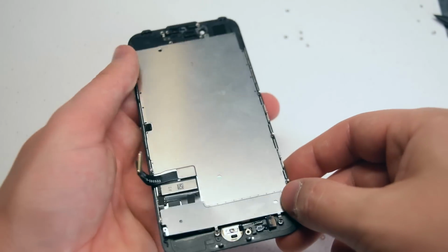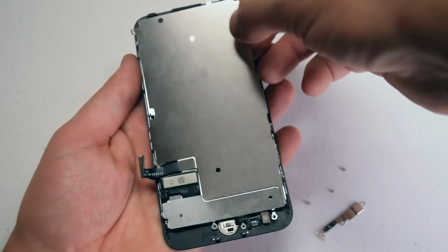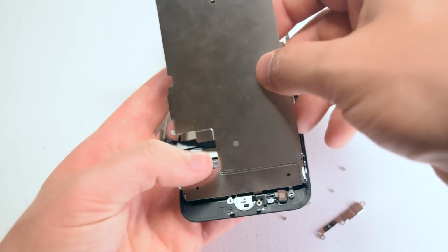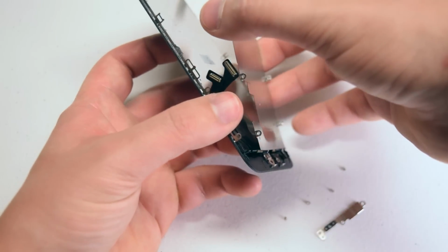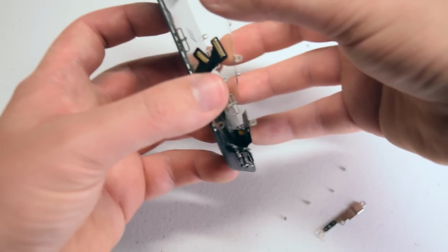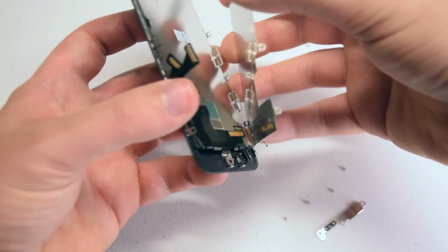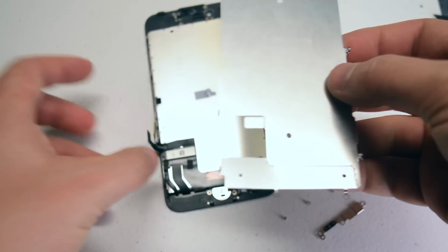With the 6 Phillips head screws removed, go ahead and pry the LCD cover upwards gently. It's still slightly glued in the bottom, so gently peel it right off of that connection like you see here. There you go. It should come out with ease.